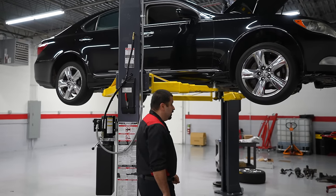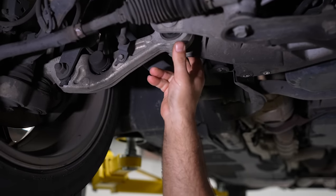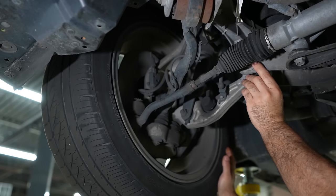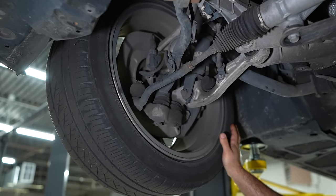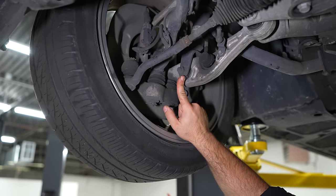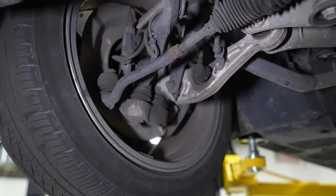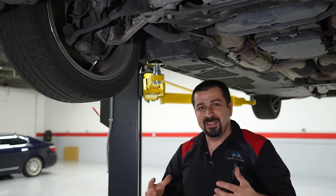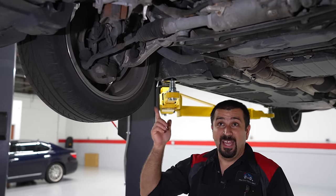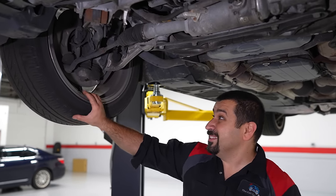Let's look at what's actually making all the movement and mess. If you look at this bushing, I can already tell it's all the way forward. Look at that enormous movement here. I got more movement at the top because the tops are shot. The strut bushing is completely out - once this gets loose, it creates so much abnormal movement that everything starts tearing and falling apart. On top of that we have the air suspension problems. The car is undrivable, basically dangerous. You're not going to drive this on the highway and feel safe - it's waving left and right, any wind will push the car.